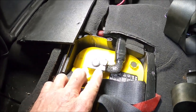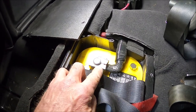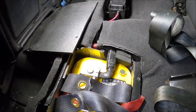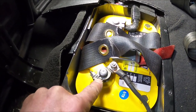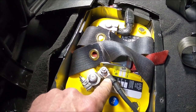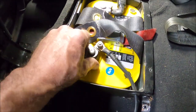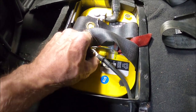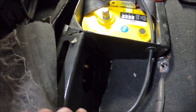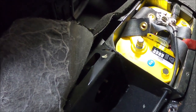I like this type of terminal - like the one I've got on the positive side, they've got great clamping force. There is no way that is ever going to come loose or spin like some connectors where you think you've got them tightened yet you can still move them. These have great clamping force and I like the fact that it's got this stud here where we can just put a ring terminal on. I'm going to go ahead and remove this cable - this is I think six gauge - I've already gotten this loosened up.